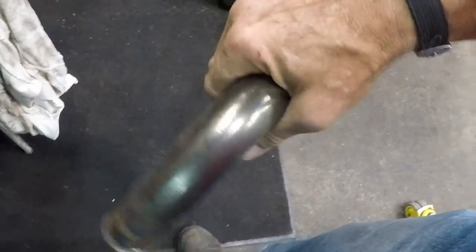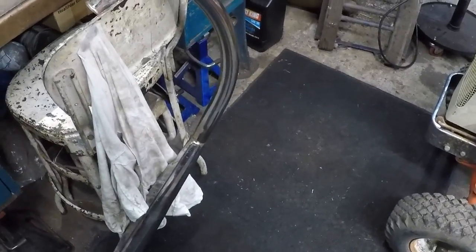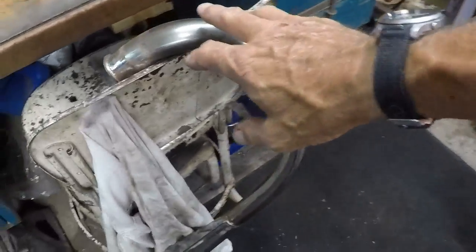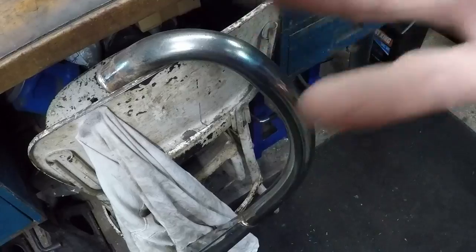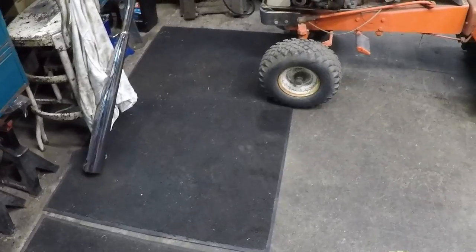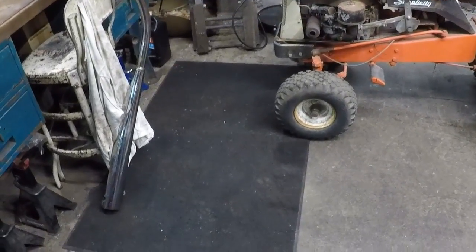Now, the reason I'm wrapping it is to hold the heat in, and there's this whole deal with the pressure wave, and you typically only scavenge 90% of your exhaust out and leave 10% in. By retaining the heat in the pipe, it helps to scavenge out more than that 90%, leaving the remaining 10%. So if I can scavenge out 95%, pull in a hotter charge, maybe I can get up to 67 miles an hour instead of 65.